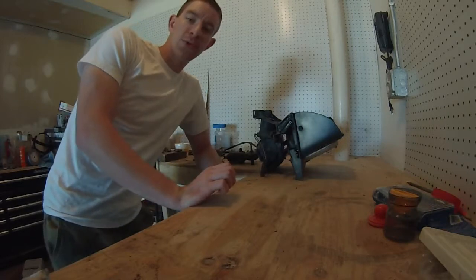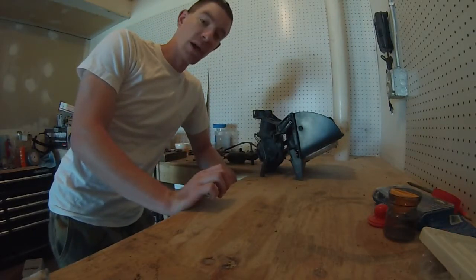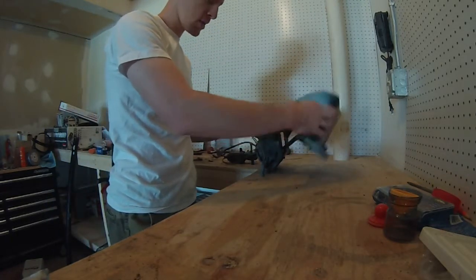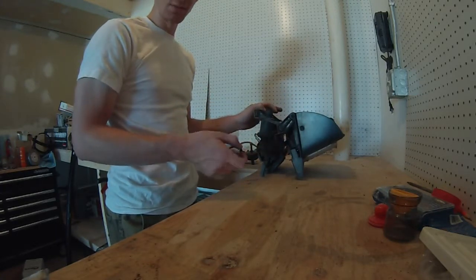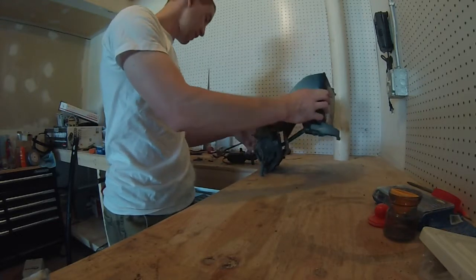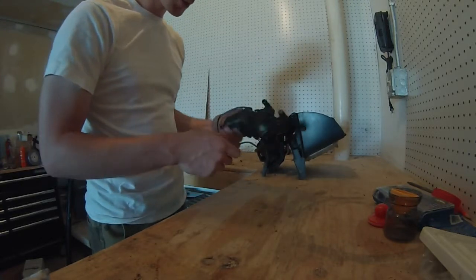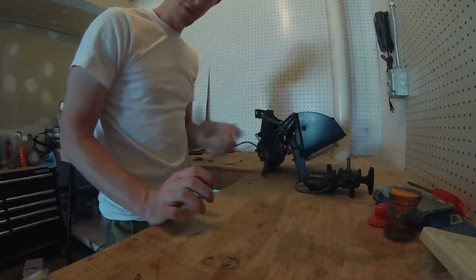So, as I hope you saw there in the time lapse, we were able to get the driver's side headlight assembly out. And it's clearly broken. You should not be able to do this with the headlight. That's all supposed to be controlled by the motor here, and it's done at a fairly slow rate, much slower than that. So, we're gonna get this motor off. Luckily, the car came with one extra. So, we're gonna throw that on there and see if that fixes it.